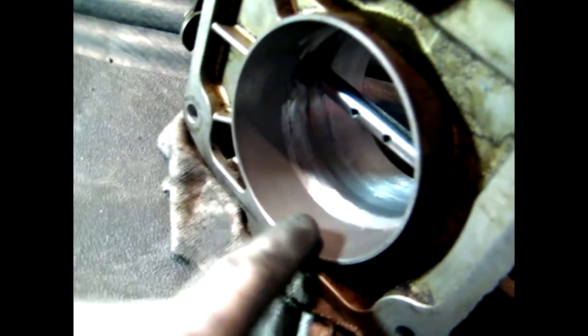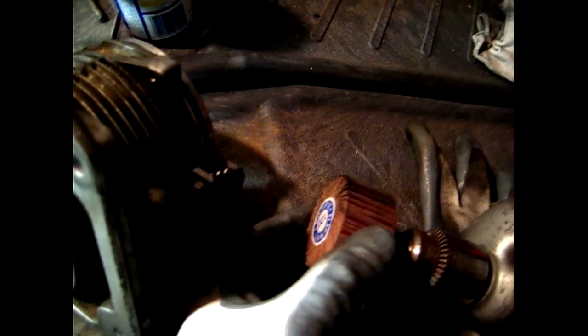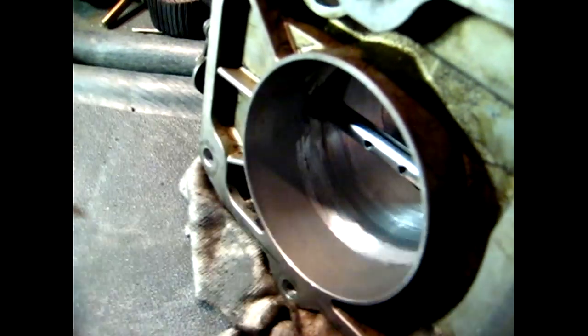Now I have switched to the drum attachment — little replaceable sanding drums for the rotary tool, available in various grits. I am currently sanding the material smoother using 120 grit. On the piece I already finished, I started with a 40 grit which is very coarse to get the majority of the porous surface out, then moved up to 80, then 120, and then up to 240. Flap wheels are also available in different sizes — I have a smaller 60 grit and a larger one.